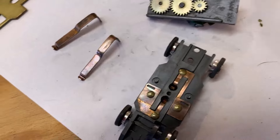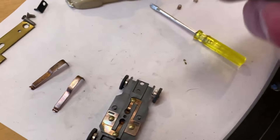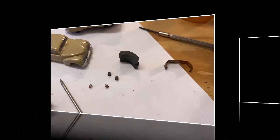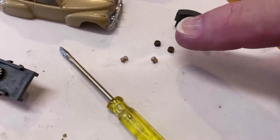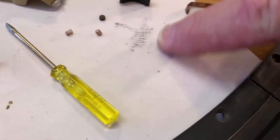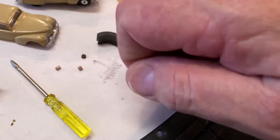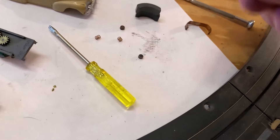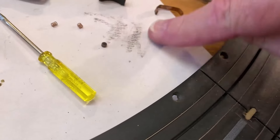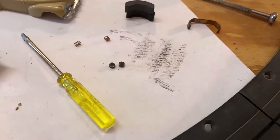Just got done with the wire Dremel. Look at how that copper came out real good, and I got the bottom of the comb plate done as well. I completely forgot about the brushes! As far as the flat brushes go, that's how I clean them — the oil and carbon just comes off. I roll them around with my fingers too. Just real easy to clean, all around. Those brushes are done.